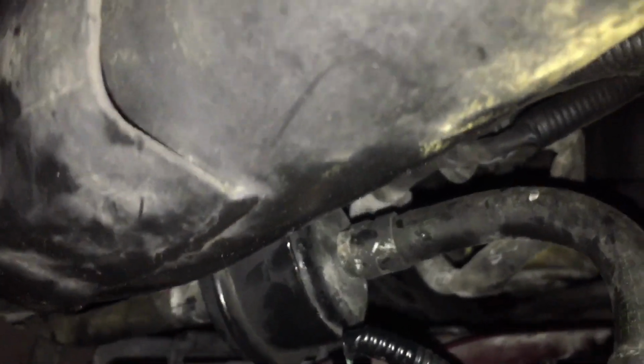Like I said, I may have to get a jump on my battery and see how it runs. But I've got a new fan temperature sensor switch, and the petcock is closed. I've drained what was in the radiator, as you can see. It kind of overheated last night, so I think some of it boiled out. I didn't realize it at first because it was running smooth, and I guess the fan switch died on me, because the fans were originally running.